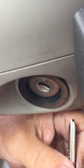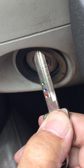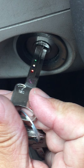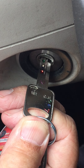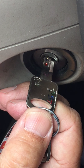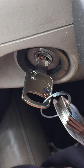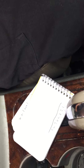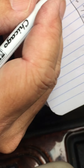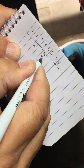We're going to go to the key marked a 2, which means it's actually a one-and-a-half key, so it's going to stop on anything that's a 1 or a 2. I'm on the odd side. I put the key in the ignition — it hits on 3 (the green), it hits on 5 (the blue), it hits on 7 (the red). So I'm going to mark it down on my sheet: 3, 5, and 7.